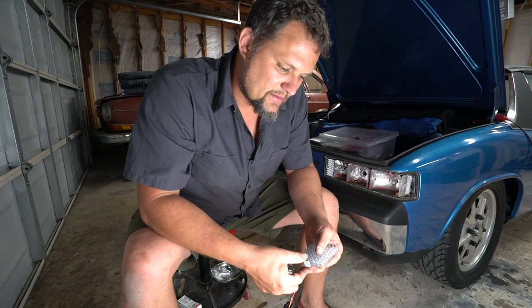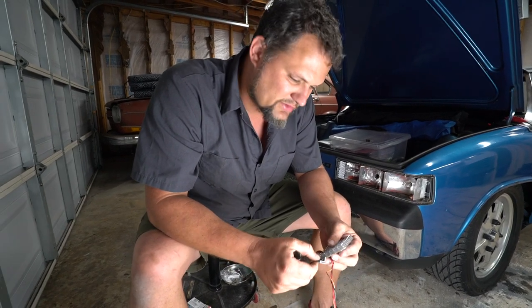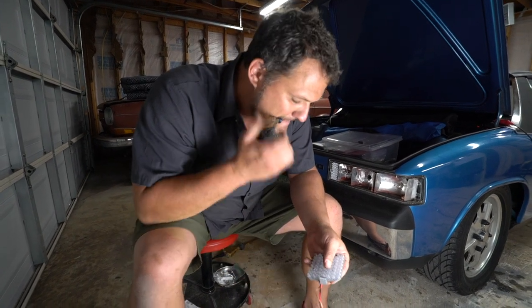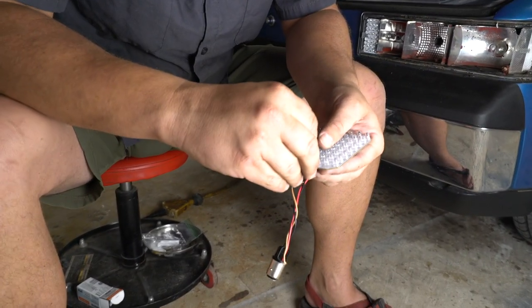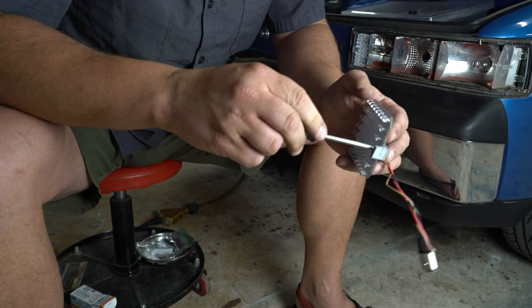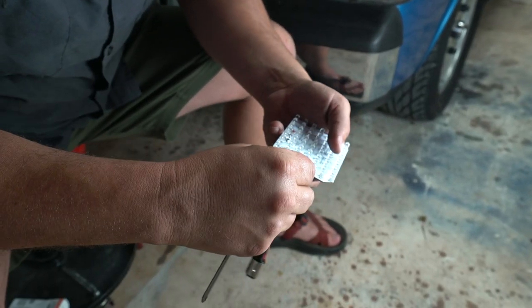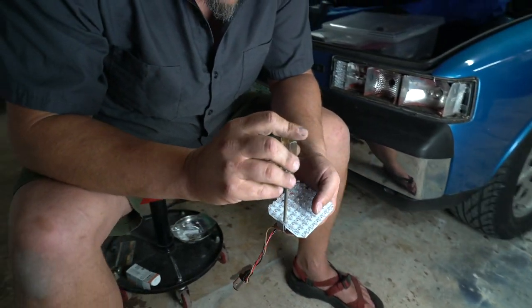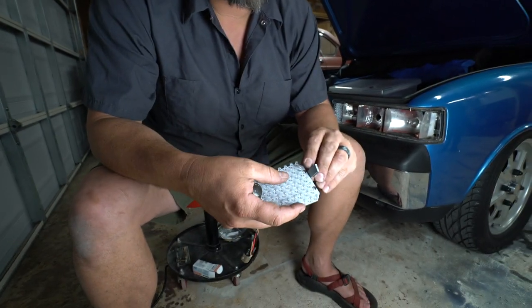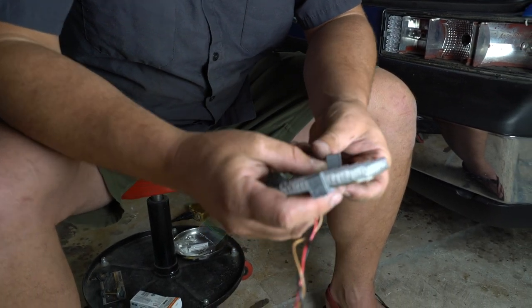All right, so this is the brake and taillight assembly. It's three wire. And so you've got clips in a couple of different places here. So we're gonna do this shallow clip on the side with one. And then we have two deeper clips that'll go on the other side. And this is what's gonna retain it into the housing. So we're gonna go one right there. Like I said, you don't need to get these super tight. And then we'll do two of these deeper ones, like this, to make sure that it goes into the housing nice and flush. So it'll sit in flush into the setup.